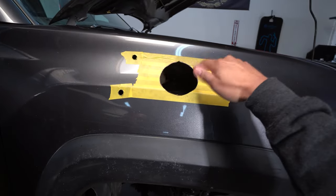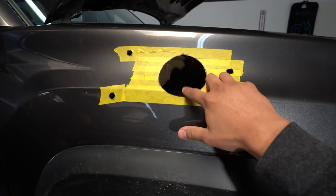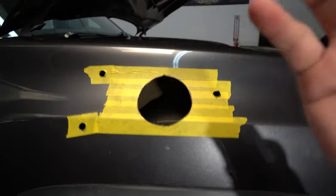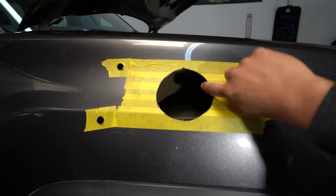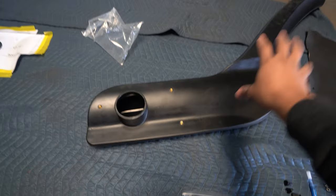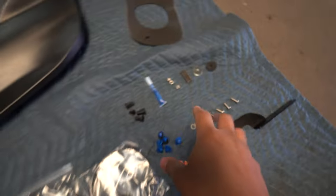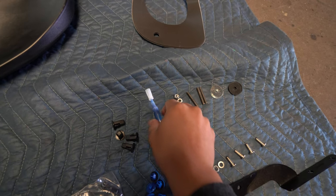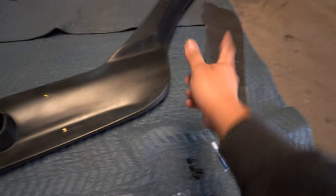The hole is done — a four-inch hole in the center, and all the other ones are half inch. Up next we're going to remove the tape, shave down the area nice and fine with sandpaper, then use your touch-up paint. That's why it's good to have touch-up paint for this installation. If you don't have touch-up paint you can use black paint on the surface so it doesn't rust over time. We're going to let this dry out, and while it dries we'll move on to prepping the actual snorkel. At the bottom of the snorkel on the back side there are three riv-nuts. We'll grab the screws, apply some Loctite, and install those into that section — then prep the washers and nylon locking nuts for the next step.